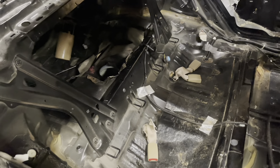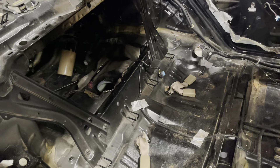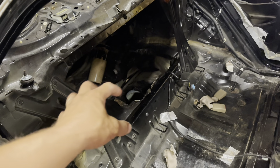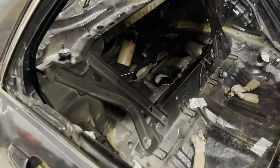What was left after draining I pulled a hose over and sprayed inside to continue flushing it out. Drilled carefully — spark and gas is not a good mixture — so I drilled a little, pulled back, let off, then went through and it was draining. We'll just put the fuel cell back in, peel that metal back a little so it's not so sharp, then tidy up the wires.